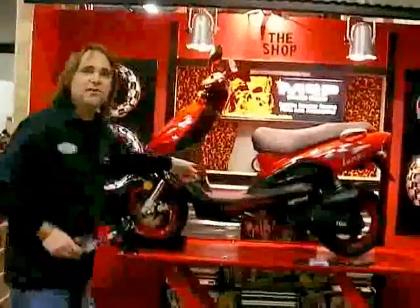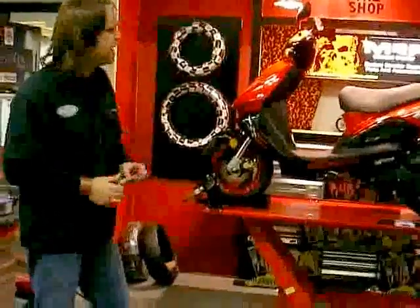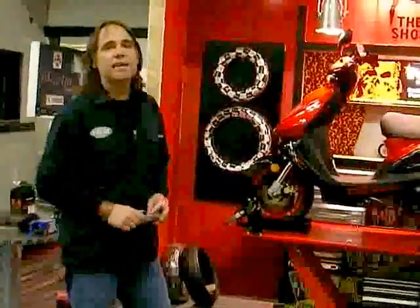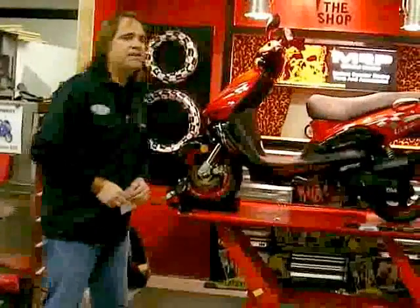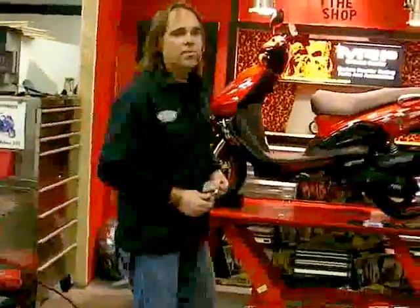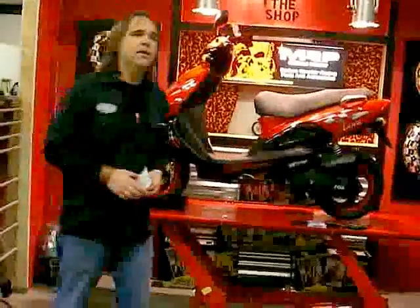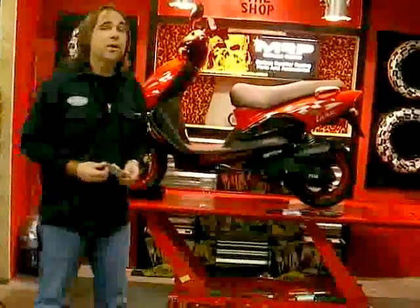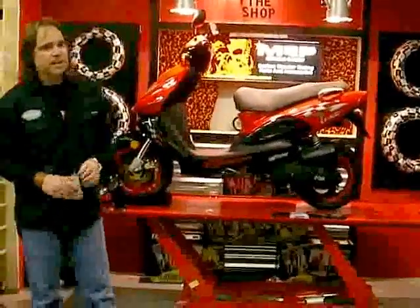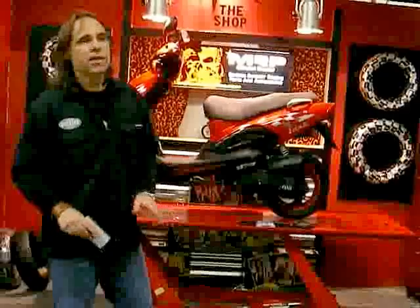We're going to look at the clutch here. We've got our TGP Laser back here, and we want to do a little transmission upgrade for this customer. The customer would like to have a lot better takeoff so he can squeeze out into traffic and not feel like he's going to get run over. The best way we've come up with is to add a combination of a high-performance clutch from MRP and probably some 5-gram Dr. Pulley roller weights — a good medium so we don't lose the top end. We're also going to add a Kevlar belt to keep stretching and slipping completely out of the picture. Stock belts stretch and slip — replace them with Kevlar and you don't have to worry about that.